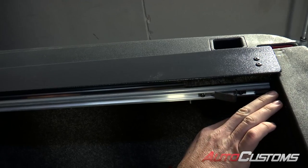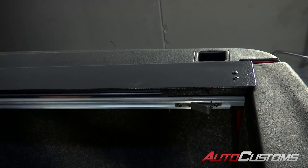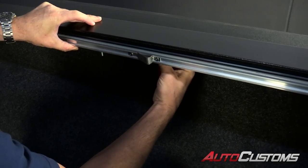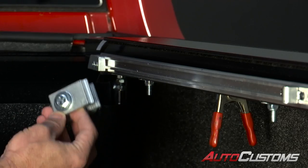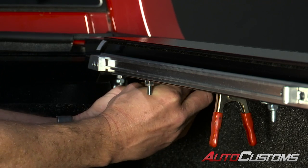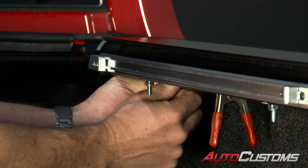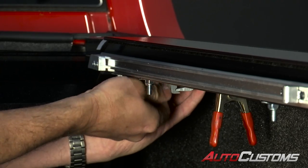If you have a drop-in bed liner, you'd want to unscrew it and position the rail about one eighth of an inch away from the painted surface of the tailgate. The same applies if you have a spray-in bed liner — just keep it about an eighth of an inch away. With the rail in place, take a couple of squeeze clamps and pinch them to the rail. Clamp the rail to the bed of the truck, sliding the clamp all the way up as far as it can go while still grabbing the grooves of the inner rail. Make sure the grooves in the clamp mate properly to the grooves in the rail, squeeze it together, hold by hand, and then hand-tighten the bolt.